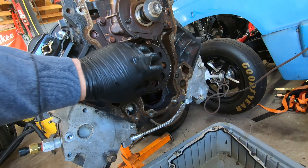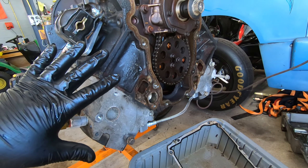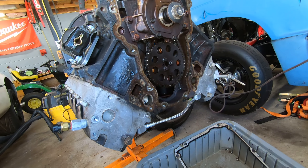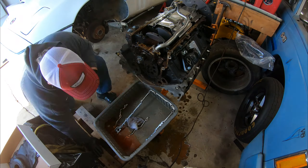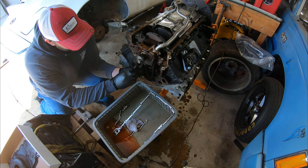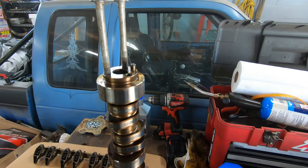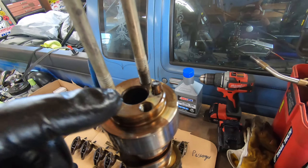Alright folks it is a nice and rainy Saturday. No better day to come out to the shop and pull the C4 engine to get this cam swapped in. I went ahead and did all the boring stuff so you guys wouldn't have to watch it. Got all the front stuff out of there, got the headers off and everything out of the way. All that's left is to pull the bell housing bolts, slide the transmission back, pull the engine mounts, and we'll be ready to fly this dude out of here. I got my Bassmaster on — let's get to pulling it.